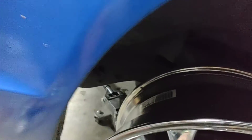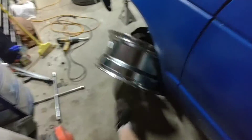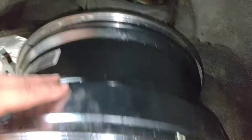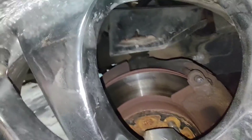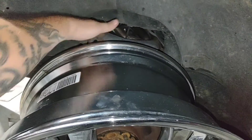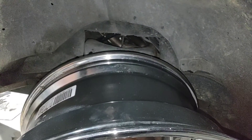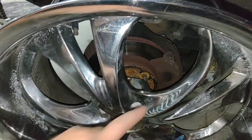With rubber band tires on there I've got that much clearance, which should be plenty of room. Wheel all the way turned, there's plenty of clearance. Back here is where I might have an issue — but it's pretty much flush, so there's plenty of clearance up here too. What I was mainly worried about was hitting the upper control arm. I've got Blazer V6 shock springs in here which raises it up quite a bit — I did that in preparation for the small block Chevy V8 I was going to put in, but I went with the LS instead, which is lighter. That makes it sit higher and the control arm go up, and I was afraid it might rub.